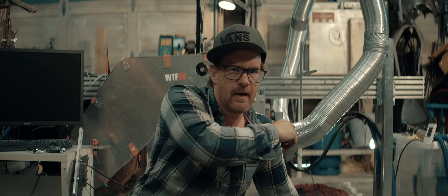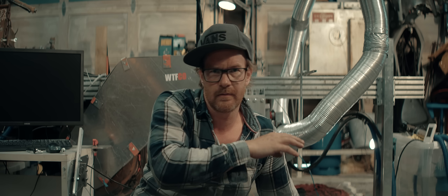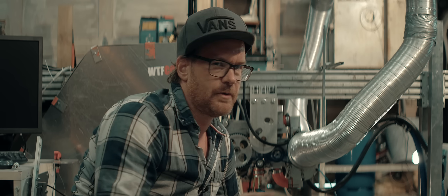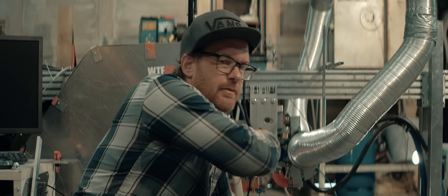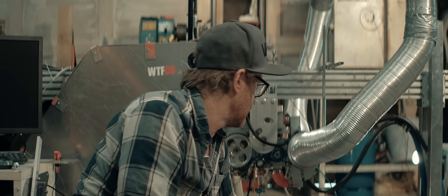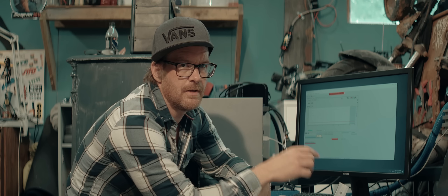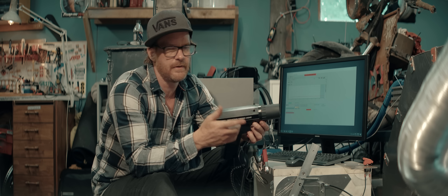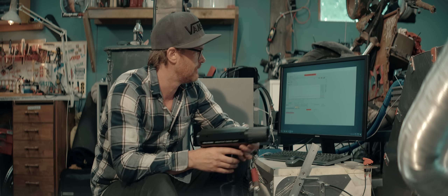Welcome back to my garage. Last time we had the first run in a while without anything breaking, and now it's time to start making some power. First up is setting ignition timing — I've disturbed the trigger locations and we need to find out where it's at and set it at the correct point. I've set timing to 10 degrees flatline in the Ignitech unit.